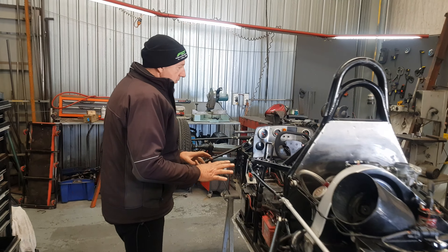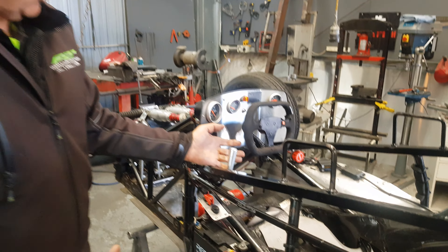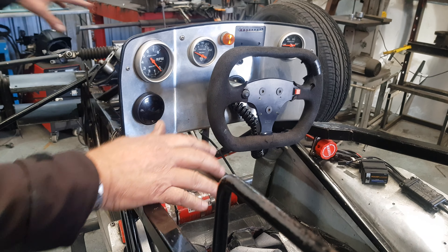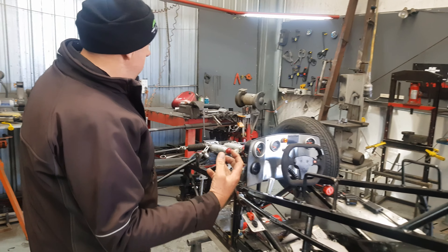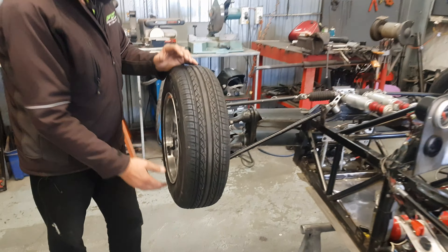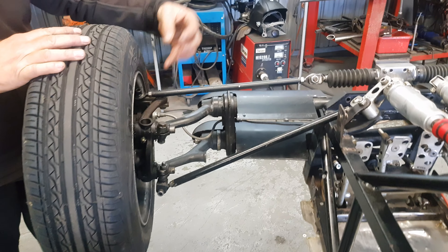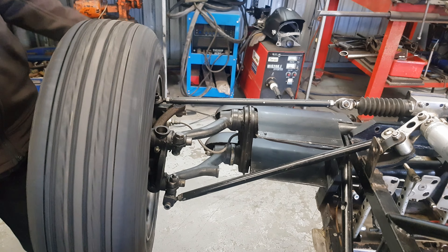Coming further forward, we come into the cockpit. Again make sure all your gear change mechanisms are nice and firm. Steering wheel — make sure there's no slop anywhere in the box out here; you're going to get a little bit of movement, it's impossible to have it perfect, but just only a little bit, not too much. Coming to the front, make sure wheel bearings are good. These are link pins and king pins — make sure they're in good order, might need a bit of a grease, but you don't want any play there, and you want it free-wheeling nicely.